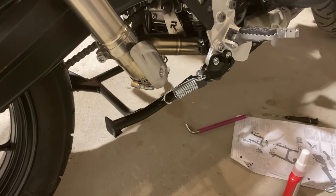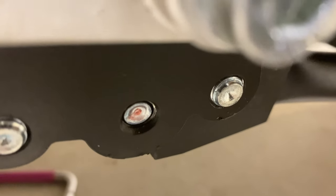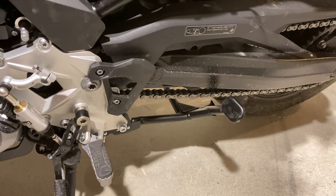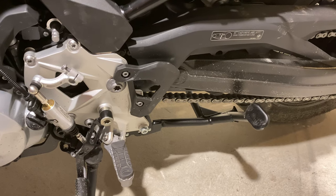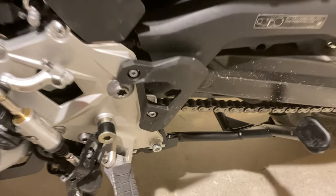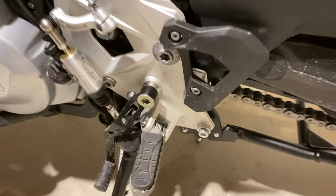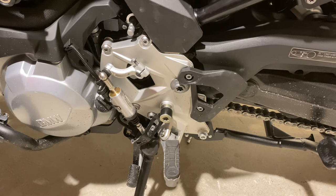One thing I noticed: on this side you can see this bolt thread on the middle comes out a couple of threads, but on the other side it doesn't come all the way out. They could have used a longer bolt on that side. So what I did was I applied high strength thread locker — the red stuff, not the blue stuff — because I don't want that backing out ever. Torqued to 40 newton meters. I also applied high strength on this bolt right here. Medium strength on everything except for those three. But you can see you're actually giving up quite a bit of ground clearance — there's your chain and there's the bottom of your kickstand, the metal silver right there. This takes away ground clearance on a lower F750GS.